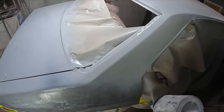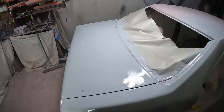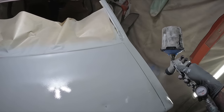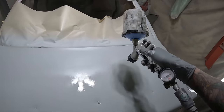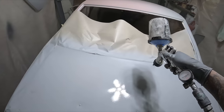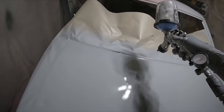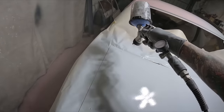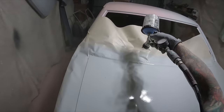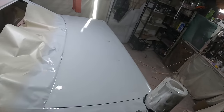The boot lid did have a little bit of a layer of rust over the top but it sort of came off with the grinder and the orbital sanders. I've just been hitting it with 16 grit, then 36 grit on the DA, then 80 grit on the orbital, and then priming over the 80 grit. The primer I'm using is a Quartz branded epoxy zinc-rich isocyanate-free epoxy primer, and I've found it to be much better than the U-Pol stuff I used previously on the inside of the doors.